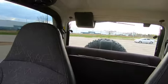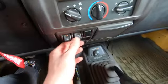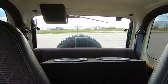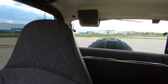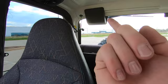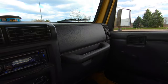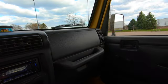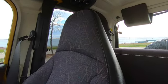Some of the last things that I'll mention is check the rear wiper motors. Those also like to go on the hard tops. So basically, just see if it moves, see if the sprayer works, and if everything is functioning back there, if it makes any funny noises. Because when I got mine, this is a different one. I actually replaced my window and I got that motor with this window. But the last one, it made a noise, like a crazy noise, sounded like a gremlin was trying to crawl out from underneath the Jeep or something. So definitely check that out, because those like to rust up and they do like to fade and not work anymore and start to seize. So just check it, turn it on, make sure that it turns on.